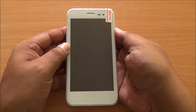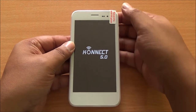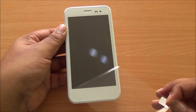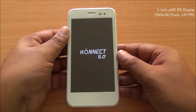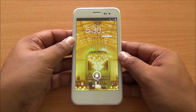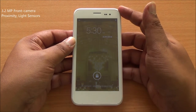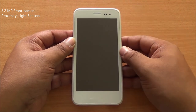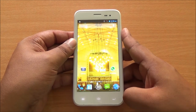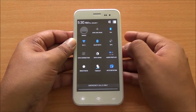However, the phone does feel quite solid. Now we are powering on the phone for the very first time. You can see the Connect 5.0 logo. Let me just remove the plastic covering the screen guard which has already come pre-applied, and then we will talk about some more specs. In the front you have a 5-inch qHD IPS display, 960 by 540 pixels. At the bottom of the display you do have capacitive buttons which should light up. At the top you have the 3.2-megapixel front-facing camera and the proximity and light sensors as well as the main earpiece. The capacitive buttons at the bottom do light up — they don't show up however until they are pressed.